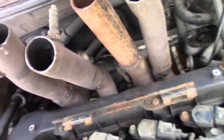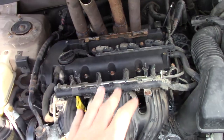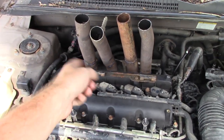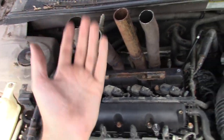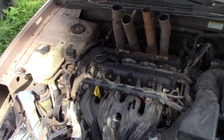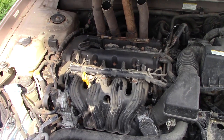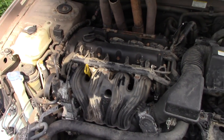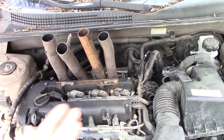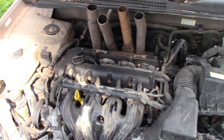This one came from one of my other cars - it still has the O2 sensor port. I intentionally put that there in case this car needed an O2 sensor to run correctly. You can unscrew the one from the original exhaust and screw it back into the header to get a reading that could potentially fix weird engine problems. Most of the time I just unplug the O2 sensor, which makes the computer default to a base programming code - the engine will still run. Be careful: if you snip the wires you can get really weird errors. And definitely do not leave them plugged in reading airflow under the car, because it will detect no air going through the engine and can throw the car into limp mode.